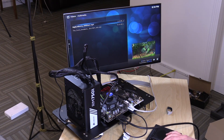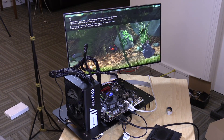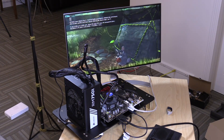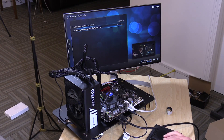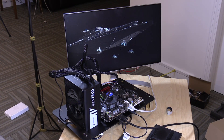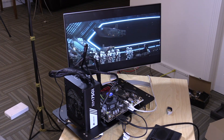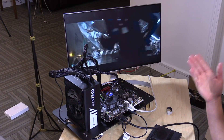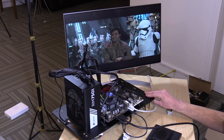One last thing to check: Kodi performance. Our HEVC 4K file plays back with no dropped frames, keeping up with high-motion video with no issues. The Blu-ray MKV test also worked very well — exactly what I'd expect from a modern Skylake processor. Really decent performance out of this build, better than I expected honestly, and there's a lot of pride in having built it yourself — putting all the components together yourself.